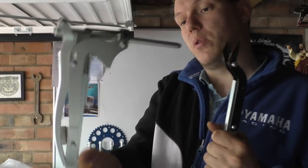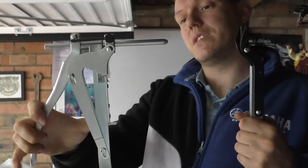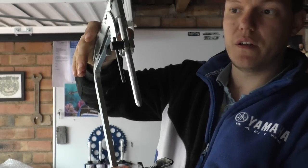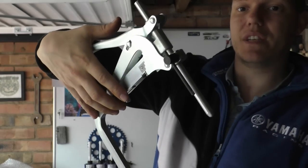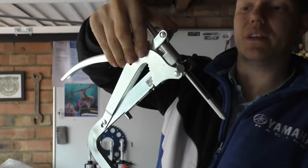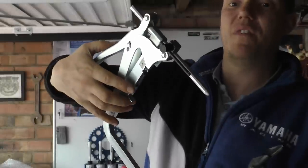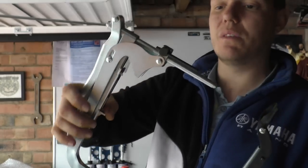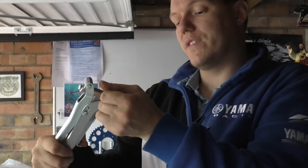What you do is pull this lever arm down, which retracts this rod. You stick this on your valve head, and when you want to compress it, that's it - it doesn't take much. You get your hand around it and just close it. It's a massive pivot - from there to this arm to this pivot here - huge. You can apply an awful lot of force with very little squeeze. And it's got this step locking mechanism - fucking beautiful.